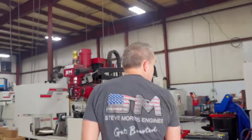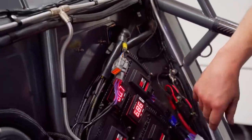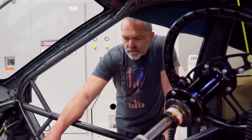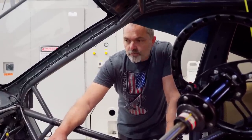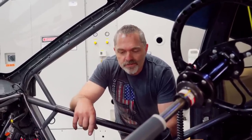Probably some of the reason why I'm having to change up some of it is we changed a couple of electronic pieces. For the peak and hold pro drivers, instead of having 4, 8, and 2 drivers, now I have just 2. So I think it's changed just slightly in my tune-up. That's why it's not right back to normal, which is fine. Anyways, we're going to continue to top this off and get ready for getting everything on it, then set it on the ground and do the chassis setup, and then probably rebuild Alex Taylor's engine, and then go to Chicago tomorrow and sleep while I'm driving, whatever, who knows.